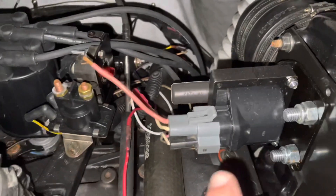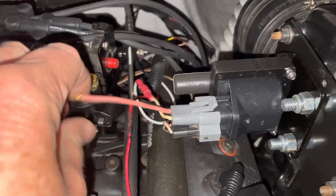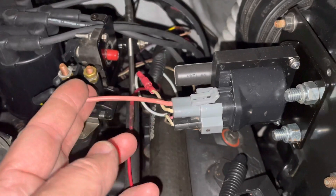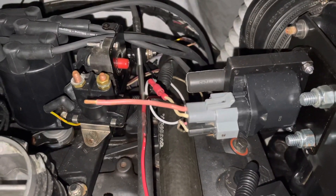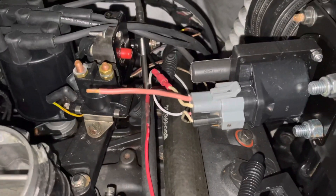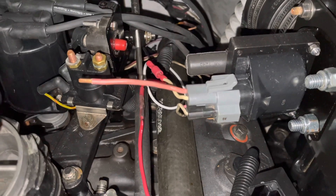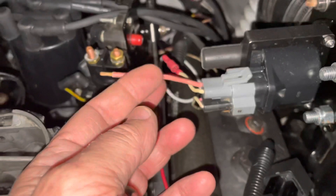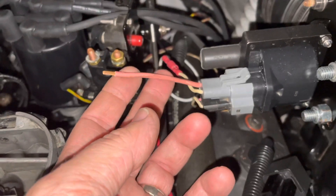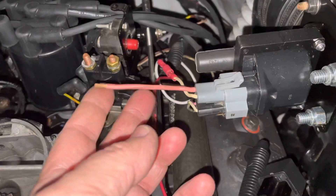This is the ignition coil as part of the Delco EST upgrade. This connector has a pink wire, and it looks to me to be at least a 14 gauge wire, possibly 12, but I think it's 14. One of the cardinal rules of wiring anything is you always go from a larger to a smaller wire from the power source. You never feed a bigger wire going away from the power source because the smaller wire can't handle as many amps. General Motors built this connector with a 14 gauge wire for a reason, so this coil must need high amperage at its most loaded condition to work properly.